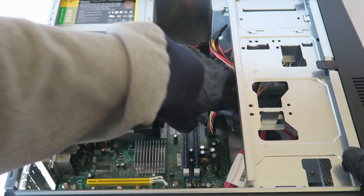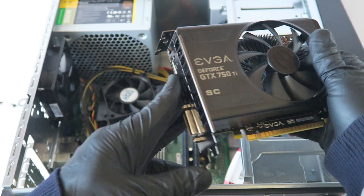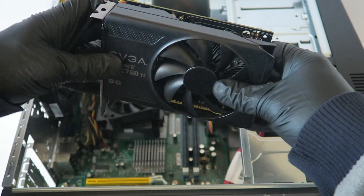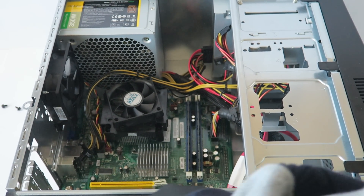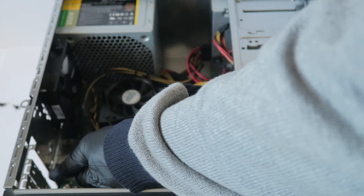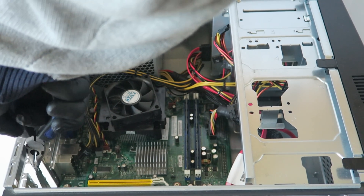At the same time I'm going to install the video card. I'm going to be using the GTX 750 Ti — it's a single fan. It's got a DisplayPort, HDMI port, and DVI port. Pretty nice — you can use this for light gaming. I'm going to install it through the PCI Express x16 slot, the yellow slot. It uses two PCI slots. There's a bracket built into the case you have to remove — I'll use pliers — gently, and it comes right out.